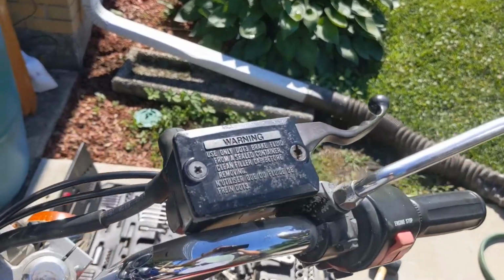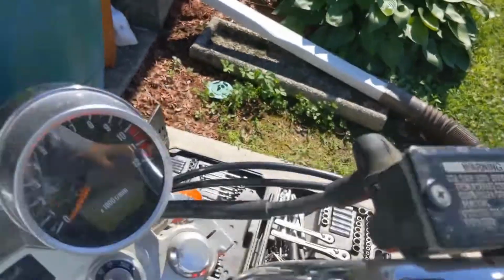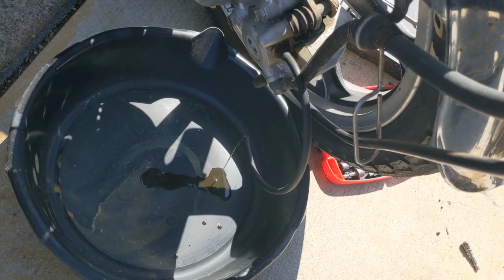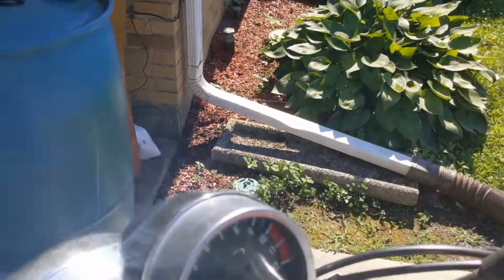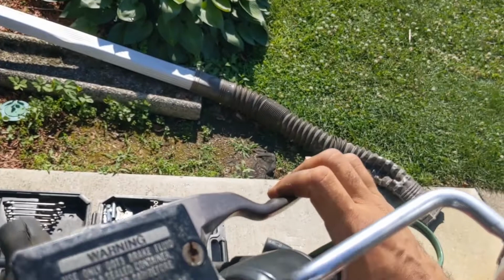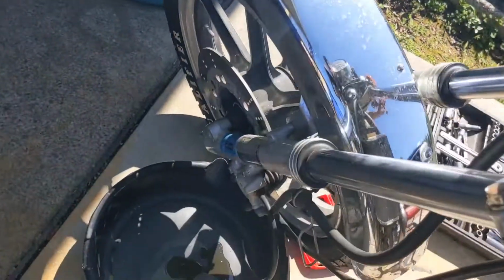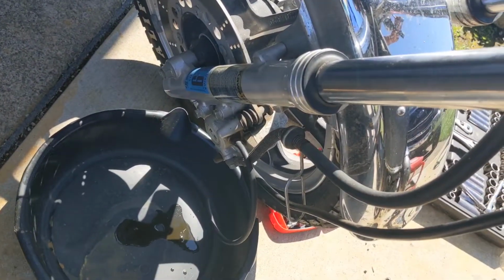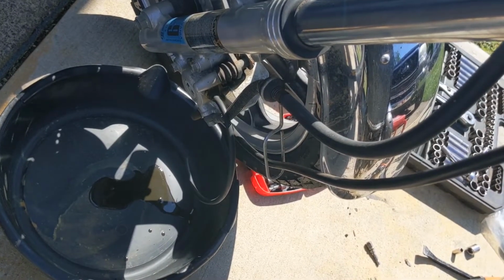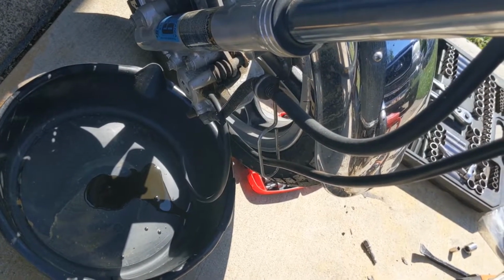Alright, so I have my screws back. Now while I'm pumping here, fluid should be spilling down at the bottom, as you can see there. It's dripping, and all I'm doing is, whoops. So all I'm doing here is squeezing right here, and then every squeeze you get some drops in there. Just be mindful of not letting it run all the way down so you don't lose pressure.